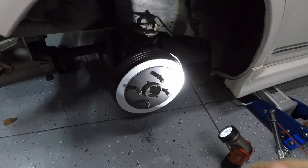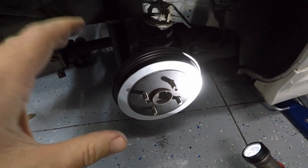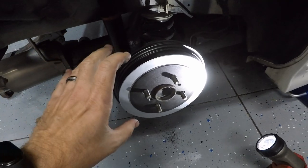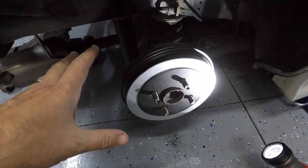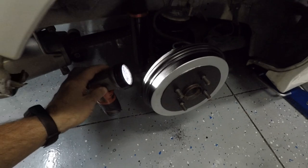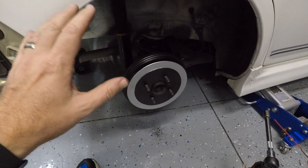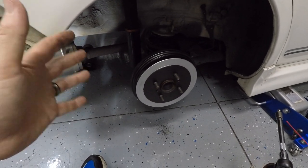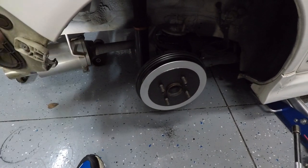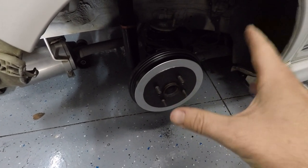I got it back on — took it off and reinstalled. Now I can do it with one hand although it's hard. I should mention: since I had the drum off, you can actually adjust that e-brake spring without even taking your wheel off. Behind the drum there's a rubber cover — remove that cover and you'll have access to turn that knob. It's probably even more annoying that way, but technically that's how you're supposed to do it according to the book — do all the work and then make your adjustments at the wheels through that access hole.